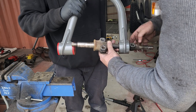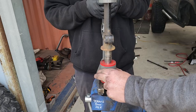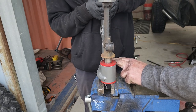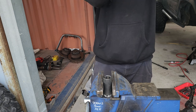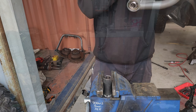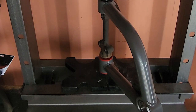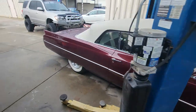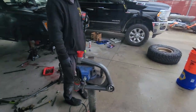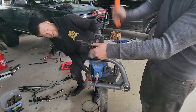And this is where we need to reuse that upper control arm bracket. We got to a point while banging this bracket in where it wouldn't budge another inch, so we took it to the press to finish the job. Most aftermarket upper control arms have 4 bushings, 2 for each side. I thought it was weird that this kit only used 3, but that's how it was designed and it seems to be working great.